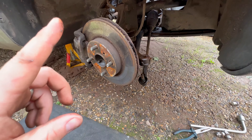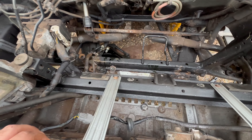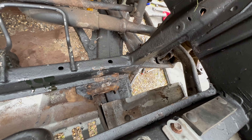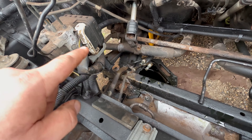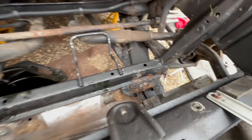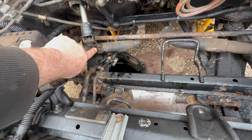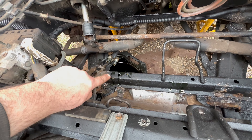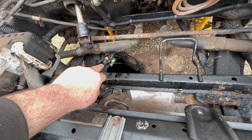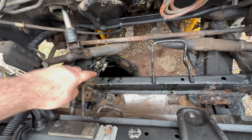With the track rod ends undone I was able to slide the steering rack out. I took it out through the passenger wheel arch because there's loads of room there, whereas on the other side you've got all the pipes, the power steering, the ABS pump, a wiring loom, and the steering joint - it's just so much tighter. To summarize: one bolt to undo the steering wheel from the rack, one bolt to undo the pipe mount, undo the two pipes connecting the pressure in and the pressure return, then the big bolts holding the rack onto the lower frame.